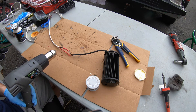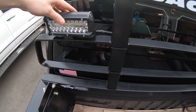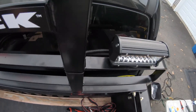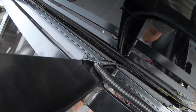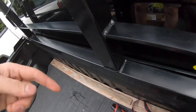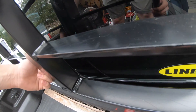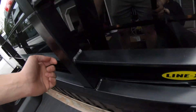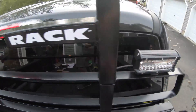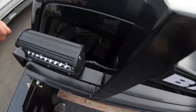The lights are mounted up — they're a little loose right now because we haven't decided on the final angle yet, but the wiring is partially complete. The wire runs down the back of the back rack. We found that there are little grommets here, but no hole at the bottom of the back rack. You could drill back there so the sheathing would be hidden inside, but that's a lot of extra work, so we opted not to.